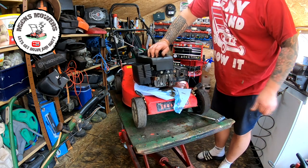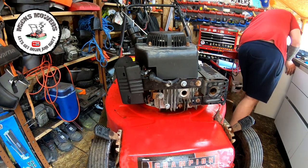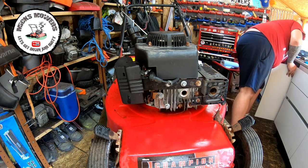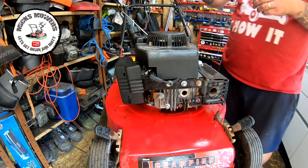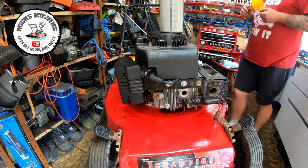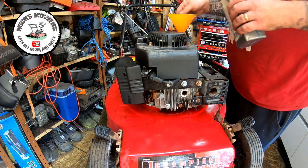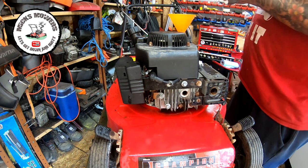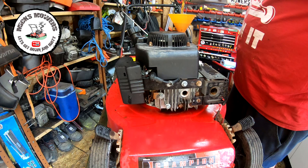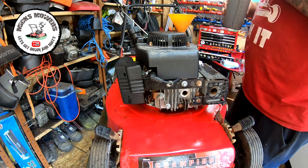This little engine may be no good. I've just literally taken the — I say the oil, but I'm going to say water. It actually had more water in it than oil, which is not a good thing. I could hear by the consistency of it, it was just chucking out water. So this engine may be no good. The engine's now got no oil in it at all — I pulled it all the way through.